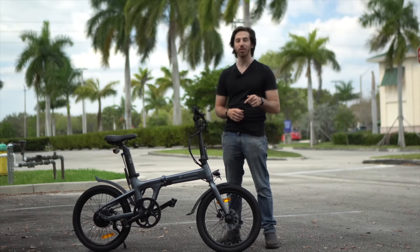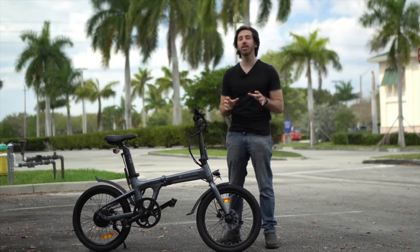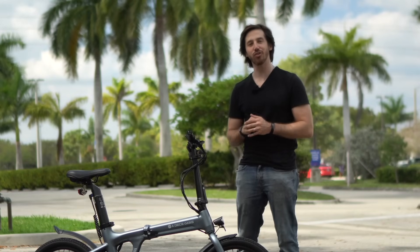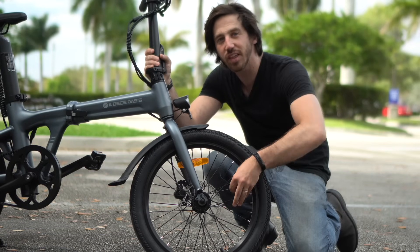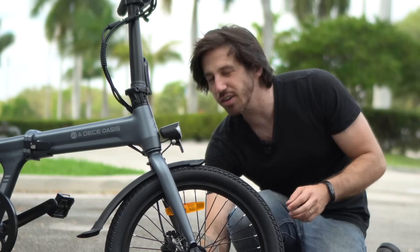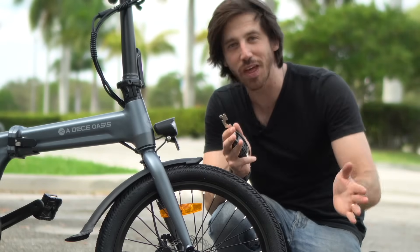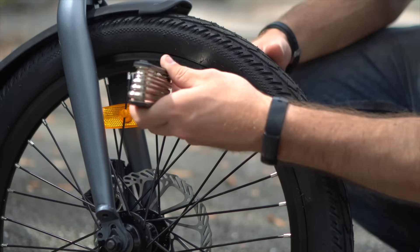Another area to consider for maintenance is your spokes and wheels. Most of the time your spokes are probably going to be fine, but if you're a heavier rider, do more miles, or have a more powerful hub motor, you could find some spokes starting to loosen up. If that happens and you don't pay attention, the more those spokes loosen the more tension goes on other spokes — eventually it's a runaway condition where you start breaking spokes. The easiest way to check is to run your fingers along your spokes and make sure they all feel like they're at the same tension. If you hear a rattling spoke, you'll need a spoke wrench to tighten it. If you have one of these bike multi-tools that come with a lot of e-bikes, open up the wrench — among the different sizes you probably have one for spoke nipples.